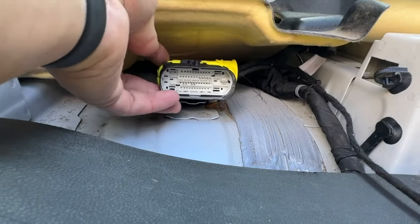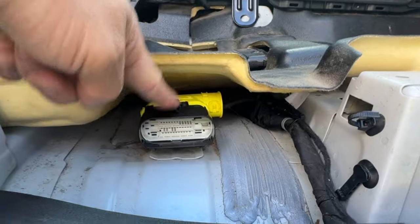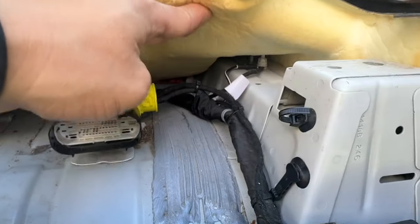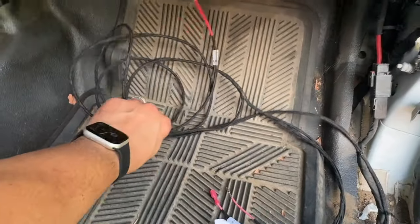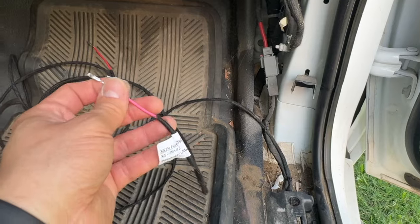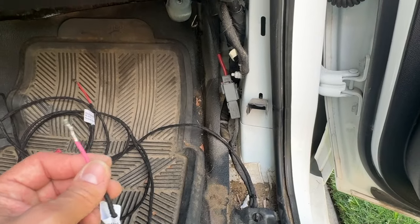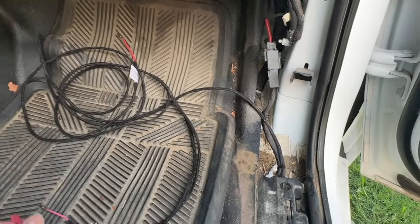One thing to note: if your truck already has any of the pins present, some trucks already have the ground wire here, so just omit that from my harness and tape it back, then land only what is missing. With everything put back together and zip tied, the ground wire landed, we continue with the wire harness down the door sill. Once you get to this part, leave the larger spool of red wire coiled in the footwell. The pink wire set will land in the passenger fuse panel. I've included a pin for the lumbar as well as an optional spade, because GM shares the lumbar circuit on this connector — this pin will land into the connector, and this spade provides a splice to bring power from the driver lumbar over to the passenger.